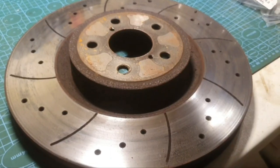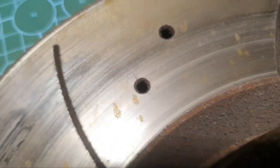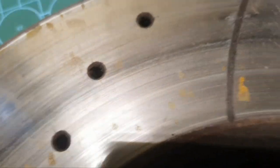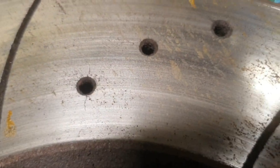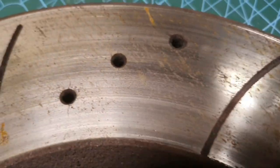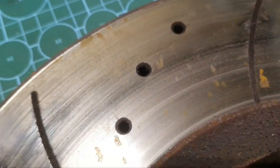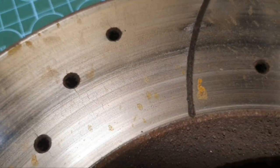I had a look around the car and found the brake discs were cracked. Here's one of the discs I've taken off — you can see the crack there, and there are loads of little cracks on the disc. These discs are about 10 years old so they've seen some use. Although they haven't done many miles, they've seen a lot of track days, which probably hasn't helped. The cracks were only very slight but they were going to need changing anyway.